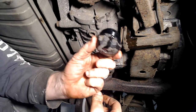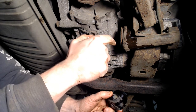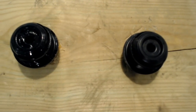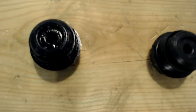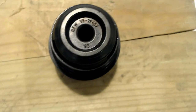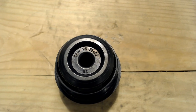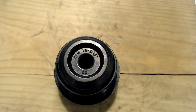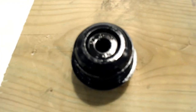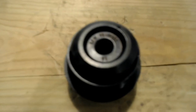With the filter out, the oil is drained. I'll give this a clean up and then we can move on to putting the new filter in. Before fitting the new filter, I'm just having a side-by-side comparison. I've checked the serial numbers on both — old greasy one on the left, new one on the right. The serial number is CFW V5-22457, the same on both. Visually they look the same and the fit should be the same. So let's get it on the vehicle.